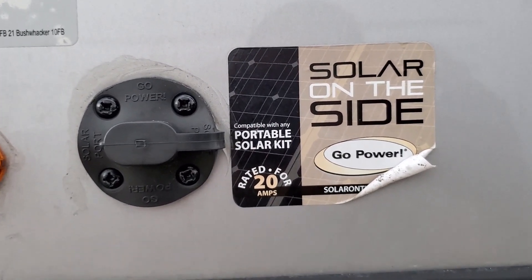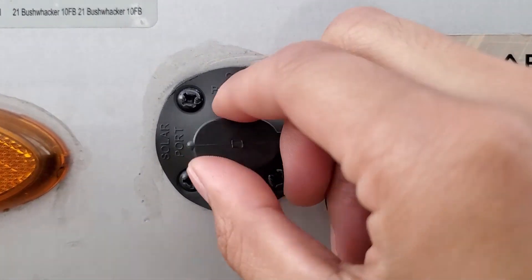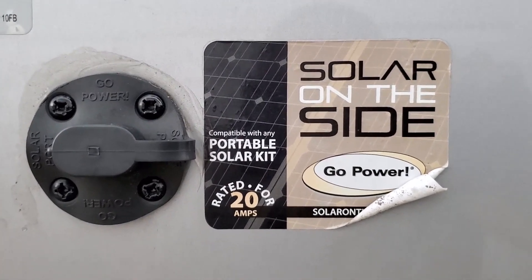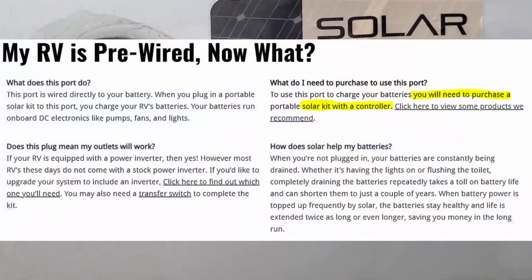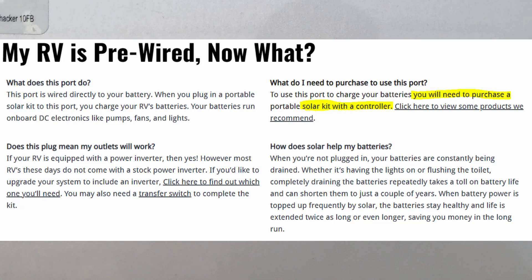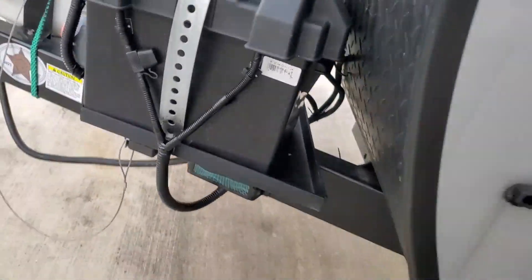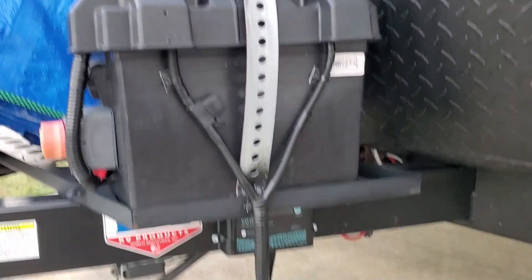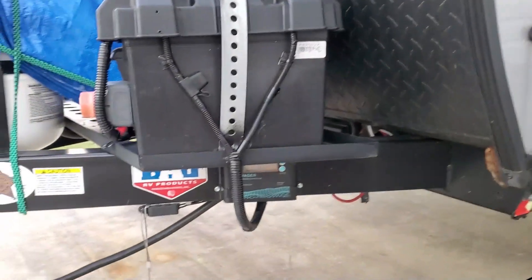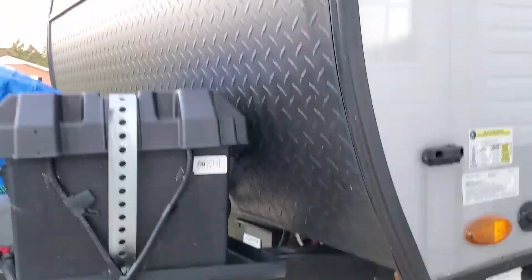The Bushwhacker comes with this solar SAE port on the side, and a lot of RVs are being installed with these. What they don't tell you at the dealership is that to properly use these without messing up your batteries, you need a charge controller and of course the solar panel. This port is usually great for solar panels that come with a charge controller mounted on the back. But in my case, I'm not going to use this port. I'm going to go straight from the battery to a charge controller, and then from the charge controller to the solar panels. I already have the charge controller hooked up to the battery — all I need to do is hook up the cable to the solar panel.